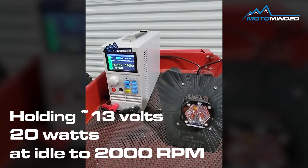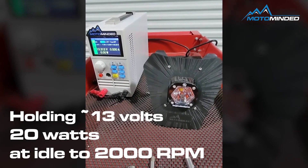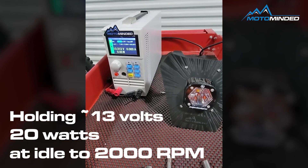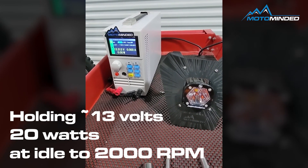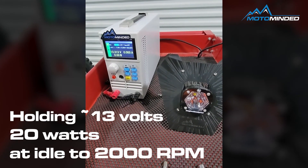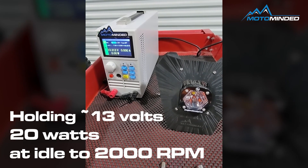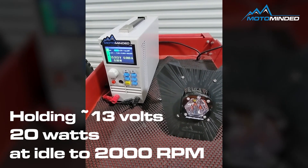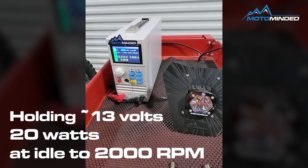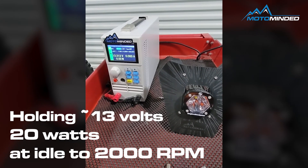In conclusion, you're good to run a 20-watt LED, just like on our Evo single LED kits with the Baja Designs LED. I strongly caution anything above 20 watts. For example, if you put a 30-watt LED on it, you're going to be around 12.1 volts, which really is not enough to push a charge into these lithium batteries and get anything out of it. Anything outside that norm, you're going to be at a discharge or break-even.